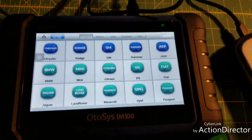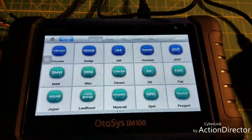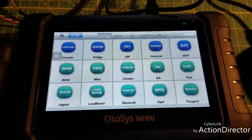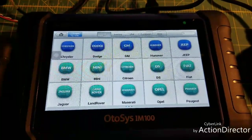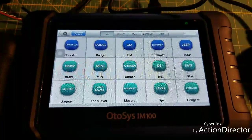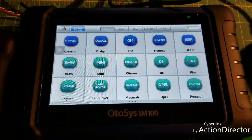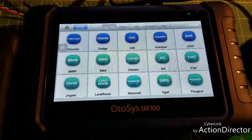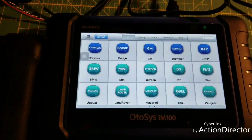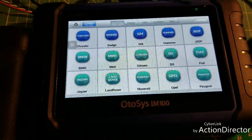For the immobilizers — I'm not going to lie, this tool is pretty awesome. I tried two Dodges and a Chrysler. I did a Town & Country, a Dodge Ram, and a Dodge Dart, and it read the pin code no problem on all three of them. I programmed a key in a 2001 VW Beetle, no problem. I was able to program a key — this is just yesterday and today, I've only had the tool two days — for a 2013 Jetta, no problem at all.